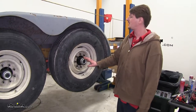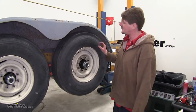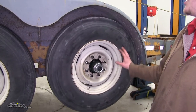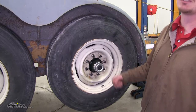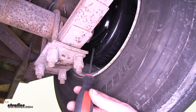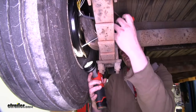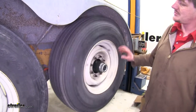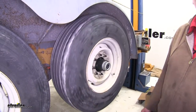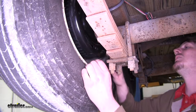Now that everything's installed and our wheel bearing is properly adjusted, the only thing left is to double check our brakes and make sure they're adjusted properly. Give the wheel a spin and listen for any kind of brake drag. We want just a touch of resistance from our brake shoes onto our drum. Make small adjustments through the two holes on the back of the backing plate using a flat head screwdriver or a special brake drum spoon tool to turn the star gear. Once adjusted, you can hear that slight bit of brake drag that slows the wheel down, so we know it'll apply immediately. Then take the small plastic caps provided in the kit and insert them in the two holes in the back of the backing plate.